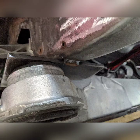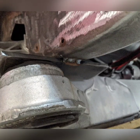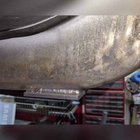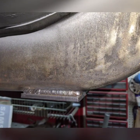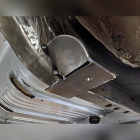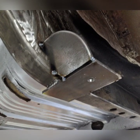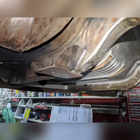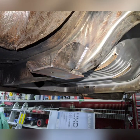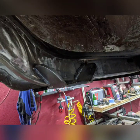With it resting square, I did a tack weld. The front mount — since it just had a small corner — got a bigger, beefy weld to make sure it doesn't move. I then carefully removed all the mounting bolts from the plates and did a full weld around them. After the flat plates were in place, I started working on gussets — four of the same in the rear to support the cantilevered area of the first plate.